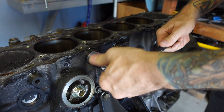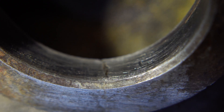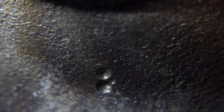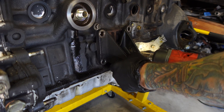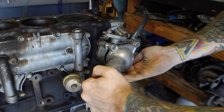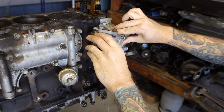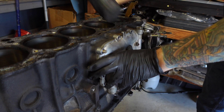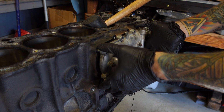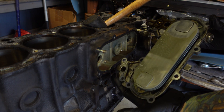Here I'm removing the knock sensors, which detect vibration or knock and look for signs of abnormal combustion, sending a signal to the ECU if present. While tearing it apart, I found a crack in the block — I go into detail about that in the previous episodes. Next up are the motor mounts and anything else that has to come off to strip this down to a bare block: the coolant elbow, thermostat housing, and the thermostat inside it. Some of the bolts are rusty and oxidized and all of this will be fixed prior to the engine rebuild. I also need to remove the oil cooler that's built into the side of the block, which I thought was a pretty cool feature of this 1FZ engine — definitely something you wouldn't see on a light-duty motor. This motor never seems to stop leaking, even when it's out of the Land Cruiser.